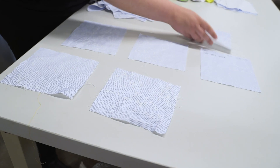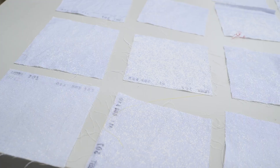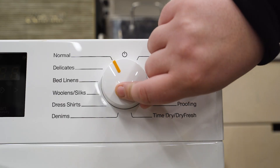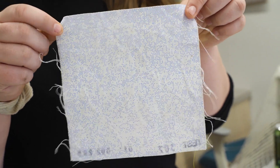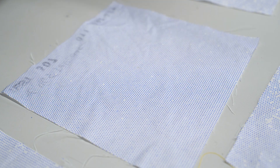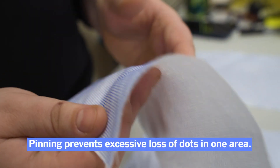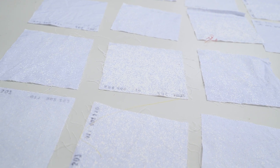This is what we call our polka dot fabric. It starts out covered in a bunch of raised dots. When it rubs up against other clothing in a wash load, the dots will fall off if there's a lot of friction. Just like the fraying fabric, we put the polka dot fabric into each machine on each different setting we tested. This one went through a lot inside the washer and that's why all its dots are missing — it was actually a heavy duty cycle, so this makes sense. This one was a delicate cycle, so barely anything came off. We pin these to a t-shirt so they don't fold in the laundry. To measure them, we scan them using a scanner and use special software to analyze how many dots were missing.